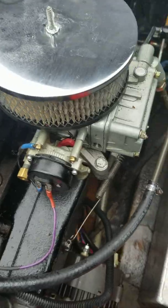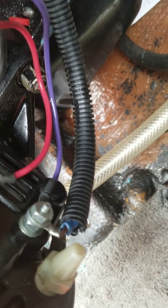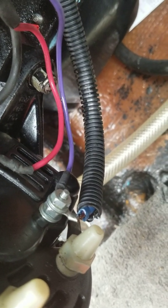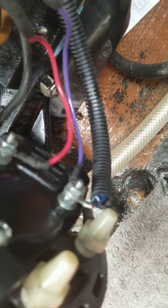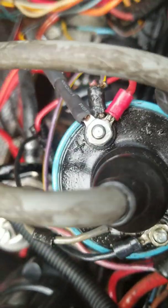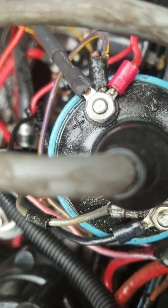After you snip the wire, come down here to your alternator. You see that post down there where the purple wire is — actually there are two purple wires. That post will already have a purple wire on it. It is switched 12 volts — nothing when the key's off, but turn the key on and you have 12 volts. Run a wire from this post on your alternator — I used red and purple — to the positive on your coil. If you snip the resistor wire, run a wire from the switched positive post, which is purple on your alternator, to the positive post.